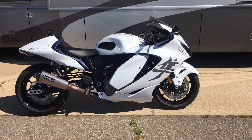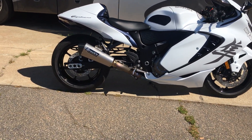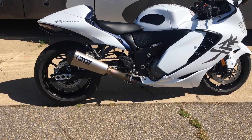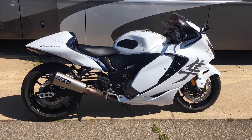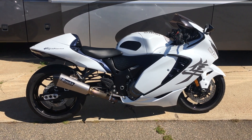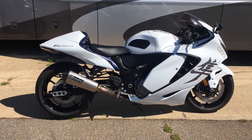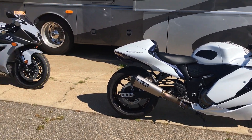The stance on this bike, because it is lowered in the front with the HTP handlebar kit — it's also got Brock's lowering links in the rear with the DME swing arm and Brock's kickstand, so the bike doesn't stand up too tall. If you lower the bike, you definitely got to lower the kickstand or the bikes tend to tip over, and we don't want to scratch a beautiful new Busa or any bike for that matter.